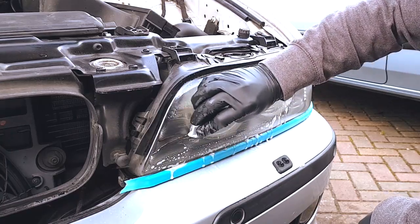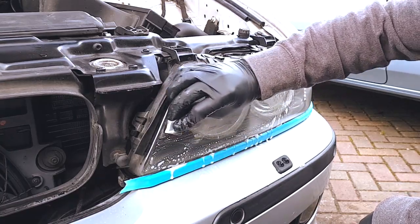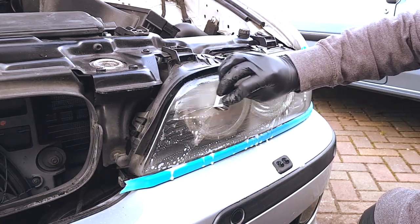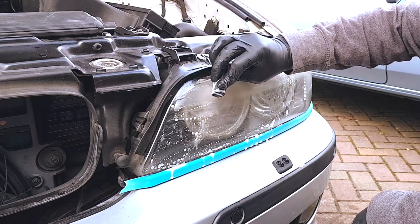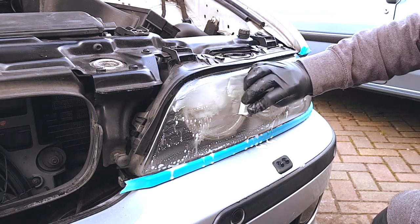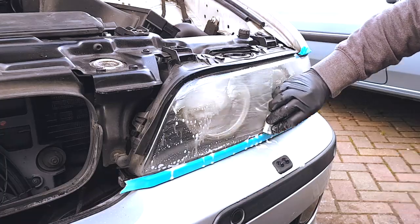So here we're sanding in a left to right action. The next grit up, so when we went from the 800 to the 1200, we sanded up and down so we could differentiate that the sanding was removing the previous sanding marks and so on and so forth, always alternating up, down and left and right as we went.